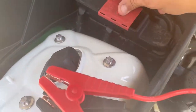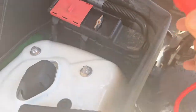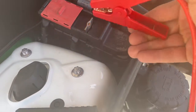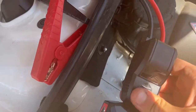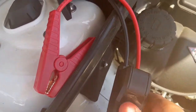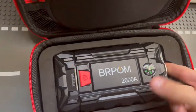You also get a little guide on top of the clamp unit: black is negative and red is positive. What you would essentially do is take the clamp — positive goes on the positive terminal, negative on the negative end of the battery. Once ready, you click the red button, it goes beep, and it's ready to administer the voltage. Then you'd have someone get inside the car and start it — that's how you jump start the car.